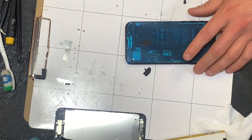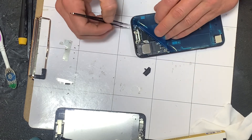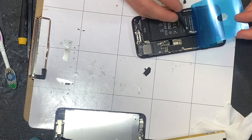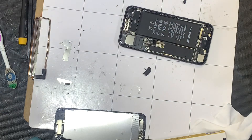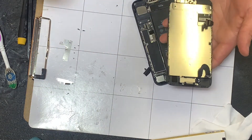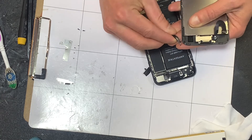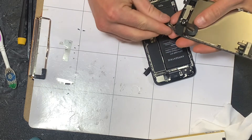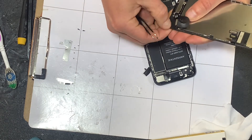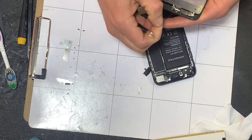Now we've got that stuck down, and we're going to gently peel — there's a tab here. Watch as it comes up. Sometimes if you don't have good adhesion it'll stay stuck to the protective film and you won't get a complete seal all the way around the phone. The main purpose of this seal is to help give it some water resistance. Once we stick the screen down, you can see there's a lip around there with some adhesive stuck on there as well — we'll get that off and have a nice fresh layer.